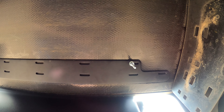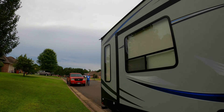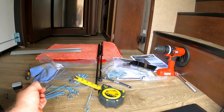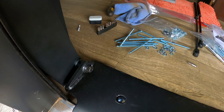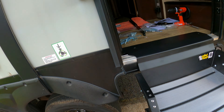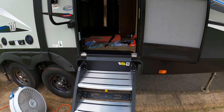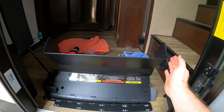Here's what I learned from trial and error. I decided to drill holes and use the machine screws along with the bottom plate, because it looked like that would be a more secure way of installing the steps — this turned out to be wrong in my case. If you're not sure which screws to use, move your steps slightly off-center and try drilling just one pilot hole with a 7/32nds drill bit. If you have drilled all the way through the flooring and the machine screw just barely goes through or does not go all the way through the underbelly material — but you have to push up and punch a hole in that material — then chances are the wood screws are the better option.